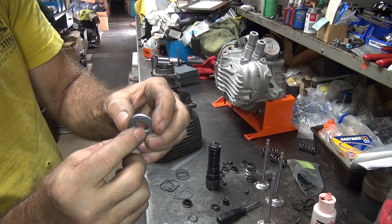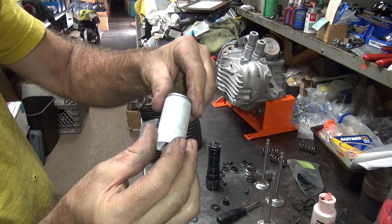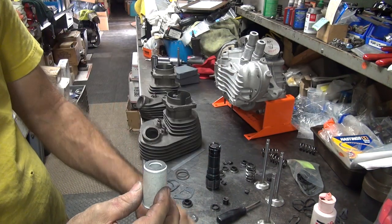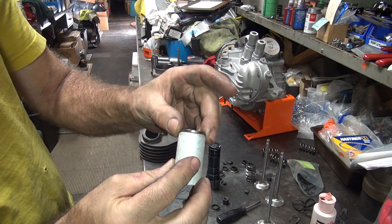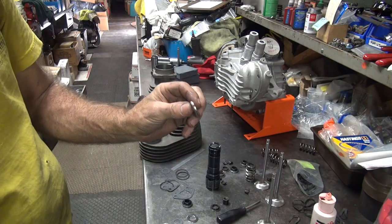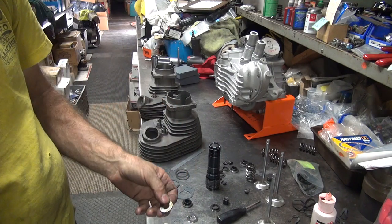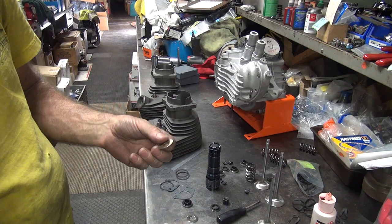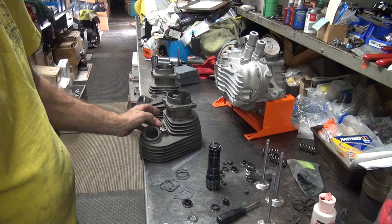Versus this one here where it hangs out quite a bit, because we're going to have a gasket on here. Versus this one, fits perfect. And the gold isn't too bad. I'm not going to see it. Paint it silver if you don't like it. It's a grade 8, it's good. Was it 92? Yeah, 92. So this has to be reamed out for 9/16 to go over the guide. And I think that'll do the trick.